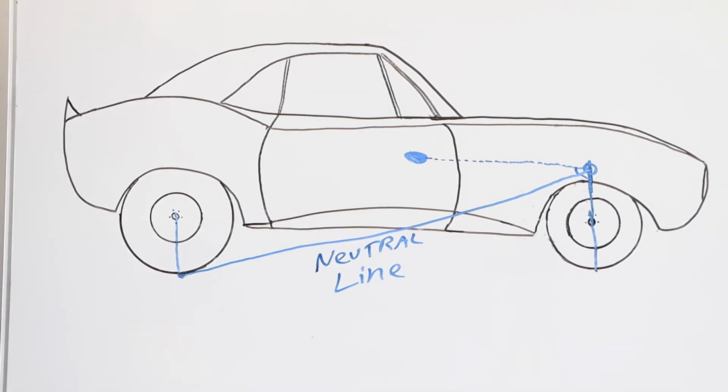Even with the exact same instant center, we know that the ladder bar, simply because of the nature of how the ladder bar works, already hits more violently and hits harder than the 4-link upon that initial reaction to torque. Well, could it be that you could hit the tires too hard? You can plant the tire too hard. You could plant it and it bounces back up. You could put too much force on the tire and you get into the tire shake or something like that.